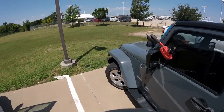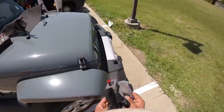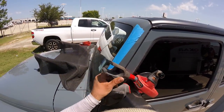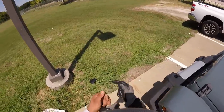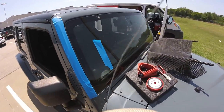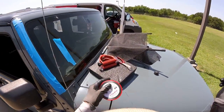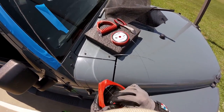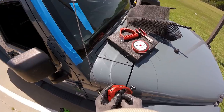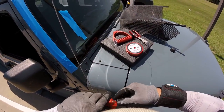Okay, see you next one. So we have this one — it's a Jeep Wrangler. Remember, this one is really light so you don't need any kind of system to install. I mean, set the glass, but I'm gonna use my WRD system because I wanted to test it and see if everything works perfect. It's almost flat but I think it's gonna match very nice. So now I'm gonna use the technique we call the wire technique. Remember, this one is very fast — the only thing you need is 5 feet of square wire, not round — it's square. So we're gonna just put this one in here. I'm gonna make a tight fast one, because I got a lot of work.